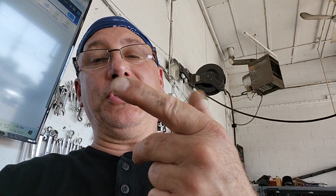The real way to know what's going on in the engine is to pull the valve cover or stick a camera inside the valve cover and get a baseline on how nasty it is. Because the cleaners are going to take that and wash it through the engine. It's going to get stuck in all the little spots that the product can't break down. The oil filter can only catch so much, because the larger parts are going to get caught someplace else before they make it to the filter. And typically that's in the oil sump, and then you're talking catastrophic failure. So if you've got a dirty engine, the easiest ways to find out are the oil cap, the oil dipstick, and pulling the valve cover. Or just very cautiously use products and monitor the vehicles.